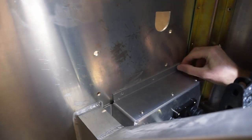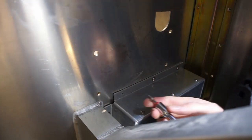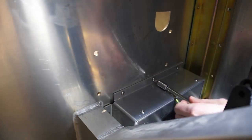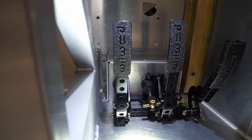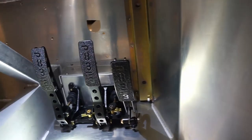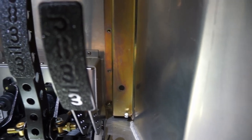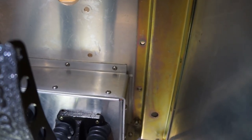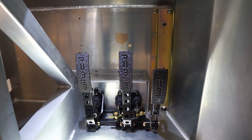It's quite difficult to film what I'm doing down in the footwell here, but I'll try my best to capture it. So here goes — temporary install of pedal assembly and pedal box. Apologies, it was a bit hard to see what was going on in there, but as you can see, that pedal box is now mounted to the wall of the footwell and the floor. You can see why it was so critical to have that corner bracket installed for the suspension. I did have to make a slight cut to that pedal box to make sure it would fit. So now that that's installed, let's move on to those remote clutch and brake fluid reservoirs.